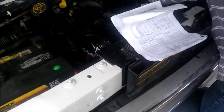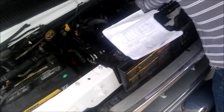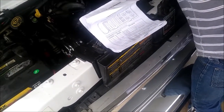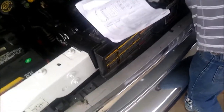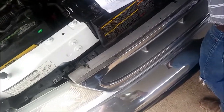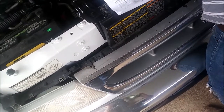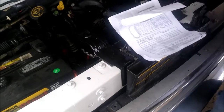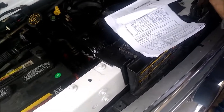The problem was we didn't know about trans codes and stuff like that — we just had that computer laying around and stuck it in to see what would happen. What really happened was we got first and second, and after second the computer got lost. We had to come back down to an idle, put it in park, then throw it back in drive just to get home, because we missed third, overdrive, and all that. So we want to see what this new computer does since it's meant for a 4R100 transmission. These part numbers are obviously totally different and the flash code on the computer is different.